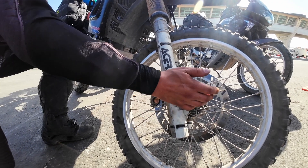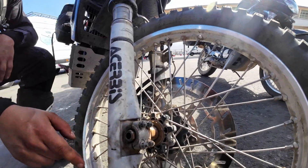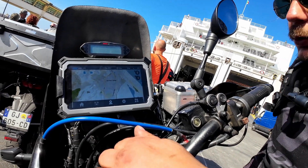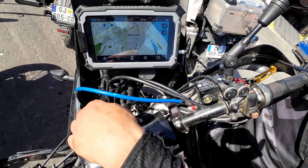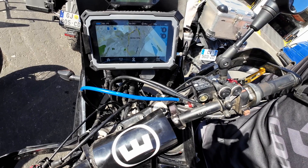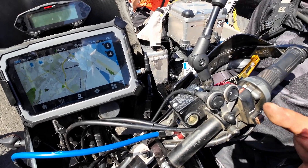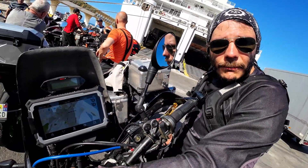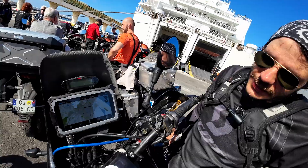You can use the TransAlps wheel, but you have to do some wheel mods with spacers and something. I didn't want to mess around with that, so I used the XR600R front wheel. If you make this front fork conversion, you will lose your holder for your ignition lock. You can build something, but I didn't want to mess around with it. I don't like keys and no one will steal the bike, so I just have a switch here — all TÜV approved. I have to carry a lock for the brake disc — it's written in the paper — because there is no steering head lock anymore. I have to carry the lock when I go riding, but actually no one cares. It's written in the paper.